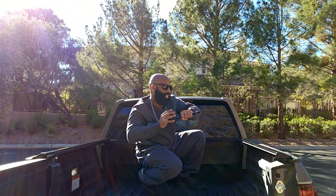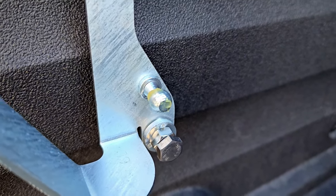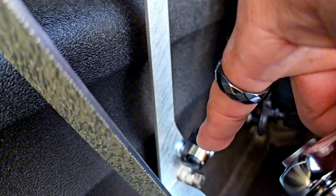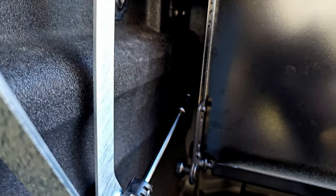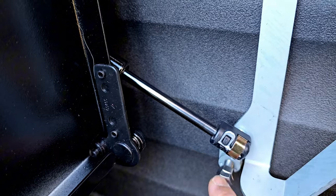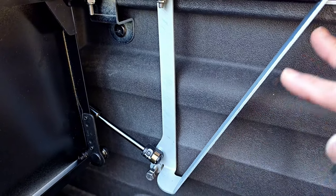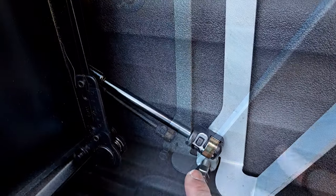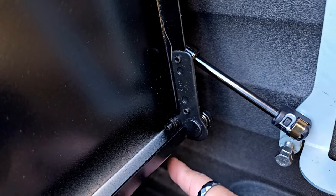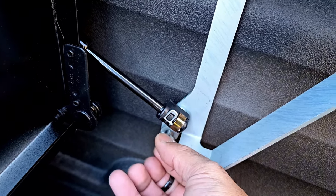Go ahead and lift one of the little clips and put your hand back there to feel for the little knob. Using a napkin to wipe some of the grease off my hands. Put the gasket bracket back on one end, the other end attaches to the cover itself — same thing on this side. The extra step here is to loosen up the nut attached to the railing. Remember: the side closest to the truck is vertical, and this side is slanted toward the back of the bed cover. Go ahead and tighten this back up so the wheels can catch the rail properly.